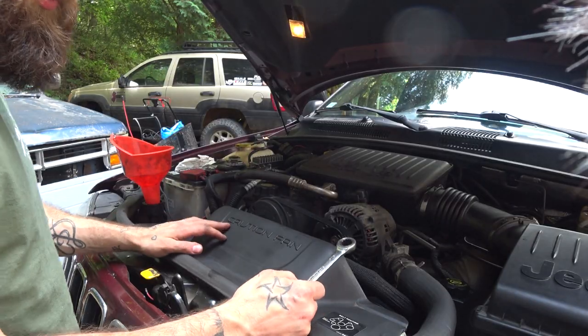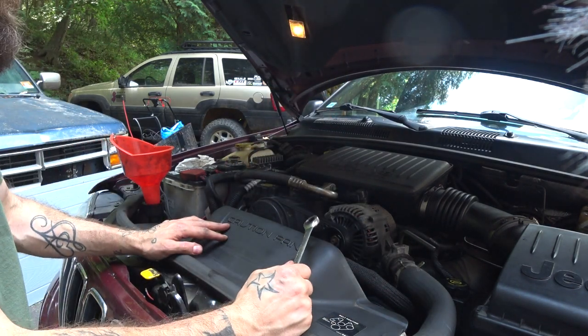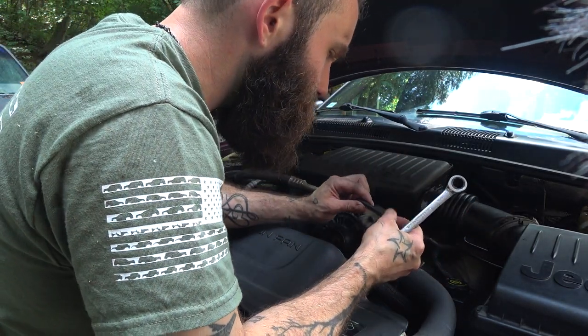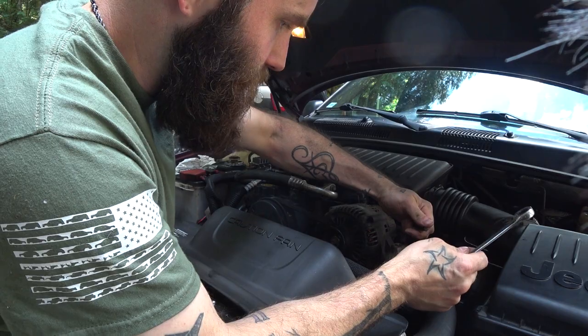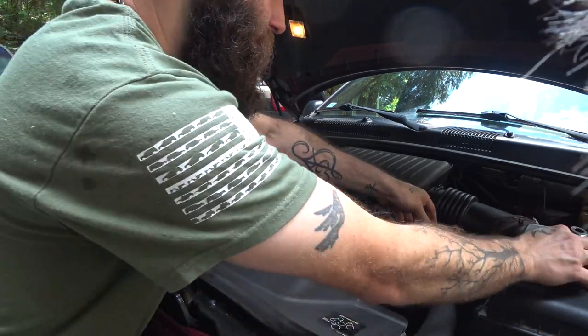All right, next thing you need to know about is the bleeding port. You have to bleed the coolant system on these 4.7 and 3.7s. The little thing right here, I think it's a 10 millimeter hex. What's this one? This is a 5/16. She seems to be fitting just right. Oh, there you go. Carefully, don't strip that out. It is aluminum, temperamental as it can be.